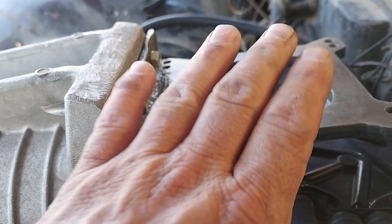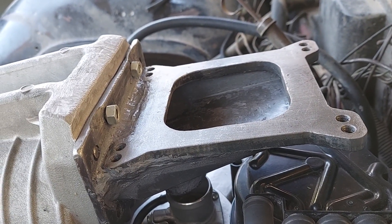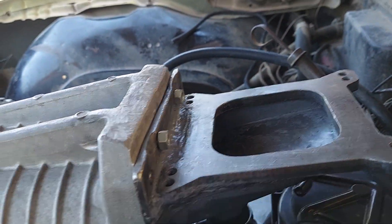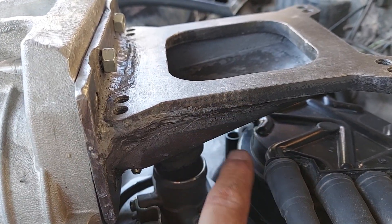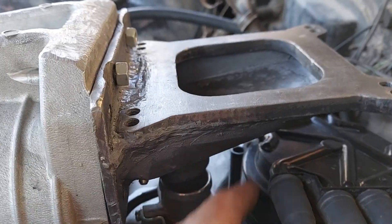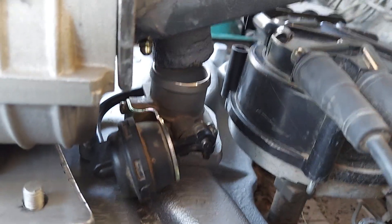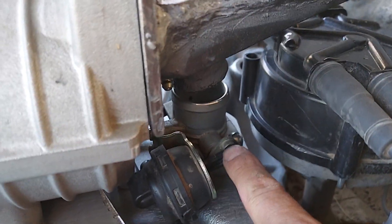I'm more familiar with welding iron — I just have a 110-volt stick welder. I grabbed a carburetor flange and some 14-gauge sheet metal, folded it, and welded it together to make this carburetor elbow. You can see it has a bypass valve — this bypass valve is actually from a supercharged Mini Cooper.